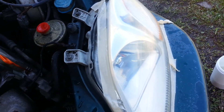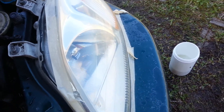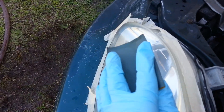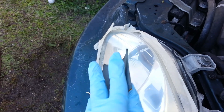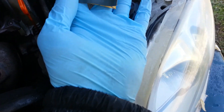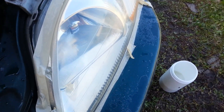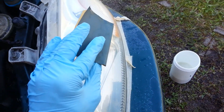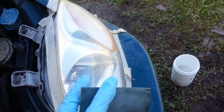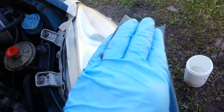Make sure you use both hands — it's ambidextrous. Use this hand going over here and come over to the other side with your other hand. When you put your hand up here you may be picking up dirt, so pay attention — all of a sudden you'll get dirt and rocks and scratch the headlights. Try to avoid that. Use one side, wash it off, flip it over, do it again — two times. It should be smooth. At first put light pressure just to get most of the stuff off, then put hard pressure and really get in there.